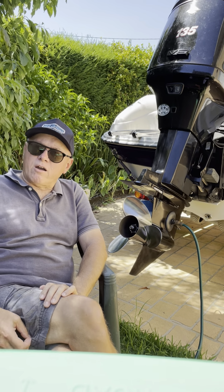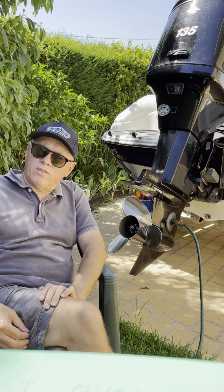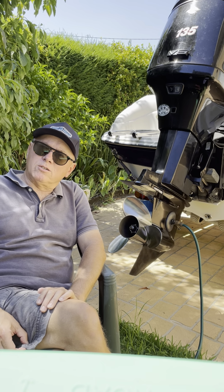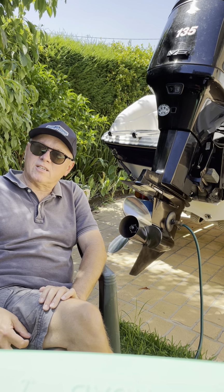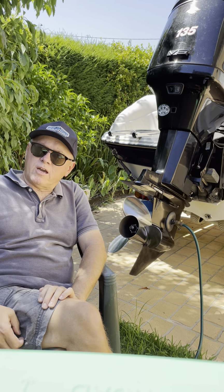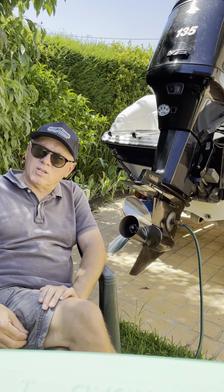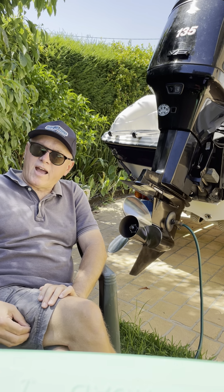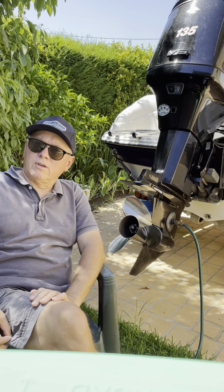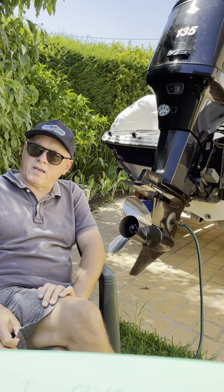and then out again via another port, it has to rely on the upward stroke of the piston to get rid of the expended gas. And up to a third of the fuel oil mix that goes into a traditional two-stroke actually gets exhausted back into the lake.